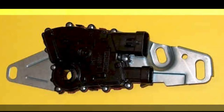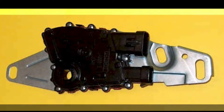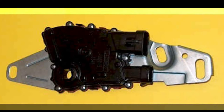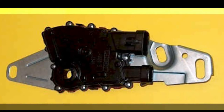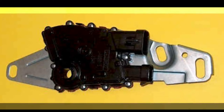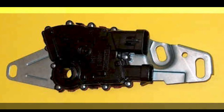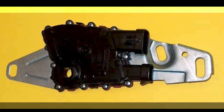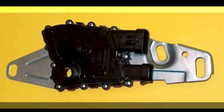There is one part of this swap that you could mess up and cost yourself money as you're trying to get the transmission, and that is this thing right here — the range selector. The range selector, when it's installed in the truck and brand new from GM, is installed with a hardening epoxy sort of glue all over the plug. So when you go to get the transmission, trust me — you do not want to mess with this while laying on your back in the middle of a field.